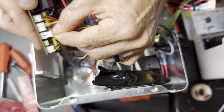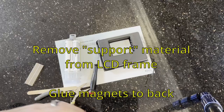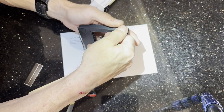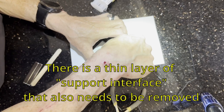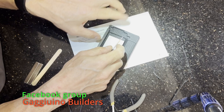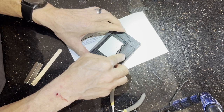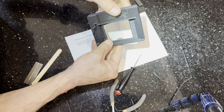Now we're plugging the SSR control wires into the PCB. If you get this printed LCD frame from me, it comes with support material that helps with overhangs during printing — you have to pull that off with pliers. Also note there's a thin interface layer you also have to peel off. If you don't remove it, the magnets won't be recessed enough. Use a small flathead screwdriver to dig in and peel it off.